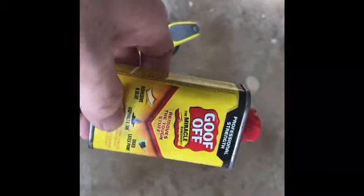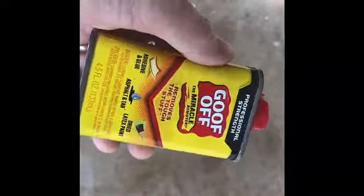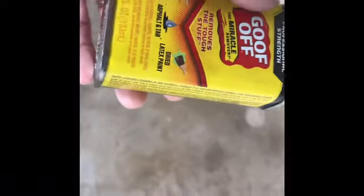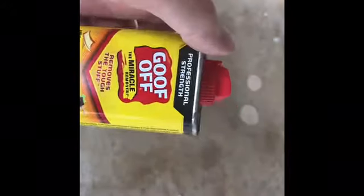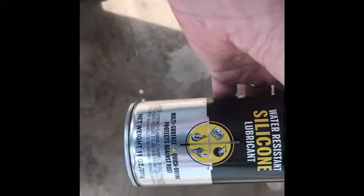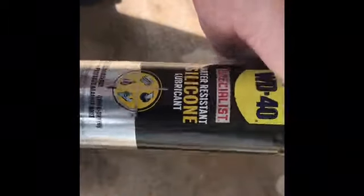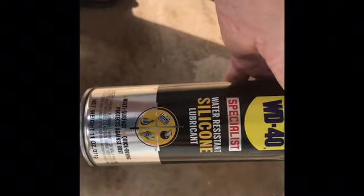Here are a couple of last-minute tips. When you put it all back together, it's probably a good idea to clean off any oil, sludge, and dirt that's around the valve cover, so that way you know if you actually solved the problem and there are no additional leaks. Wipe off any oil that was around the engine block. When putting the air hose or PCV valve back on, they can be a little tricky, so spray a tiny bit of lubricant on the hose and it'll slip right over. It won't cause any problems with sensors — it just helps it slide on a little bit better.